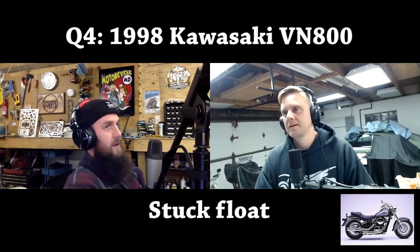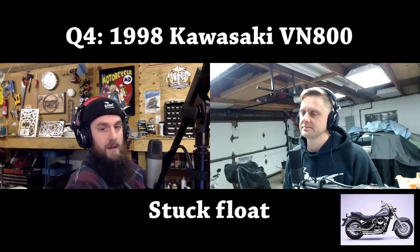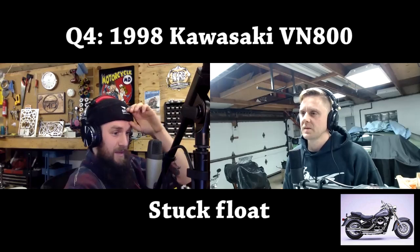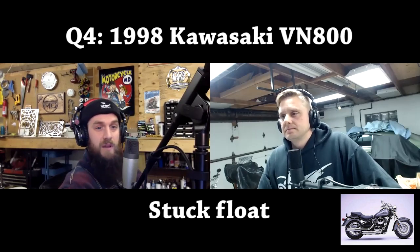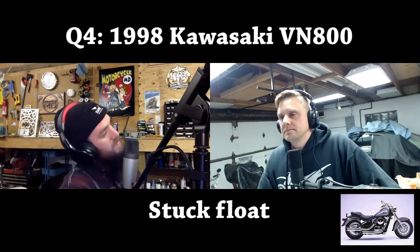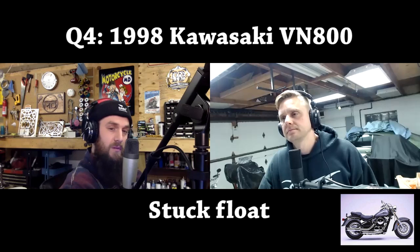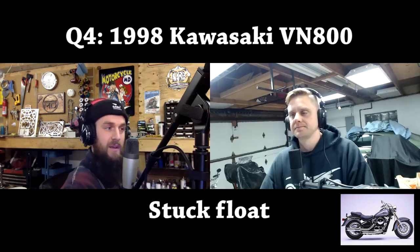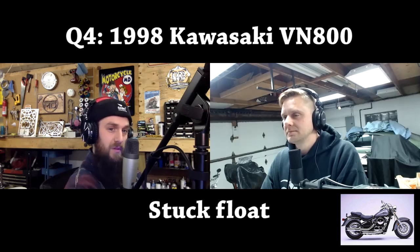So the one thing I'm concerned about with that is I'm not sure how the starter works. If it has starter reduction gears and goes into a Bendix, or if the starter has a gear that shoots out and then attaches to the gear. I mean, dude, you know what a Valkyrie is? Honda Valkyrie. I've seen those hydrolock because cylinder two has a vacuum line to the petcock. Okay. And the petcock sticks open because of varnish. Yeah. Cylinder two is the only one that fills up, and then it starts to bleed into the crankcase after that. Sure. And guys start turning through, boom, snap the gear right off the starter reduction gear, which requires the motor to be pulled. Brutal.